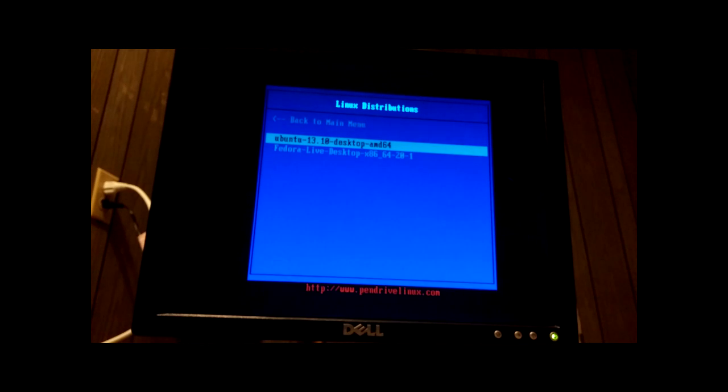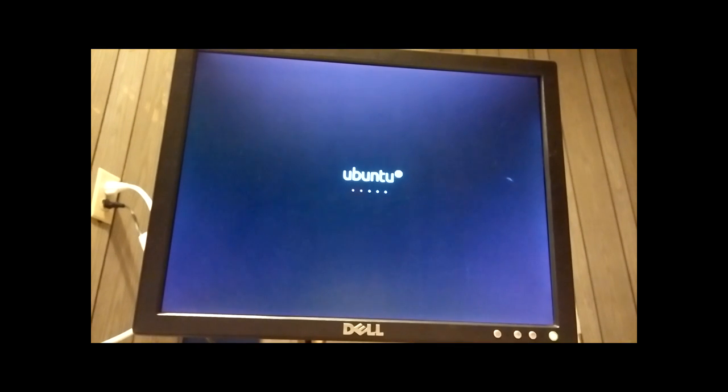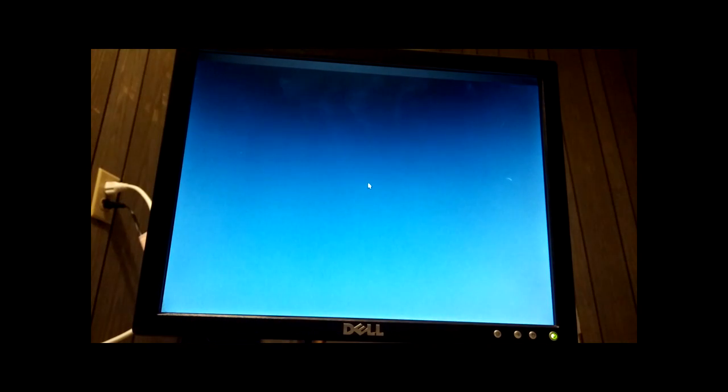Once you click the USB device, you just follow any step that shows up. This doesn't have any second step, and you see how quickly it loads up the bootloader for YUMI. This is the bootloader, and basically you have to press something or else it's going to automatically try to boot into the main system again. Since we have Acronis, the antivirus menu shows up. There are different menus that can show up depending on what you install on it, but we have the Linux distro. I believe the other one is the system, what's it called, system images or something like that, system software.